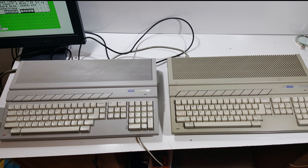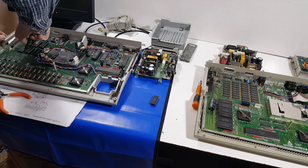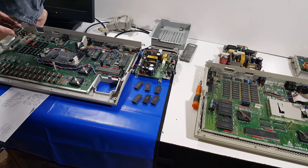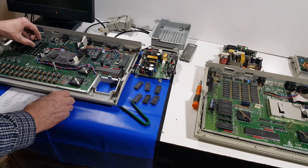To make a long story short, I continued to have nothing but trouble with this particular motherboard — it was more often than not just generating bomb codes. You can see the two systems I was working with: the two pictures on top are the original system and the two on the bottom are the second system. The board and power supply from the second system were in much better condition. I was troubleshooting the chips and moving the TOS sets between the two as well as all other socketable chips. What I was able to determine is that the chips in both motherboards were all good. The problem appeared to be inherent with the first board — it was full of rust, so obviously it was some sort of bus issue or connection problem with one of the sockets.